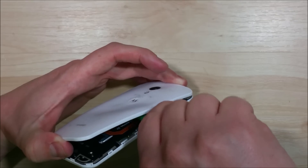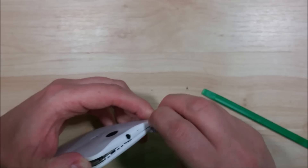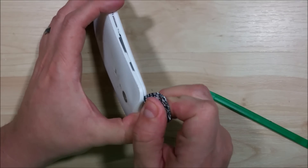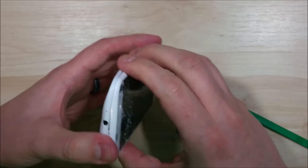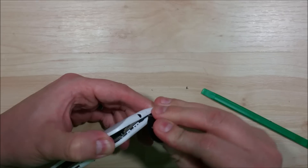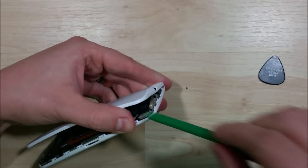There's a sticker on top of the battery — the X8 Motorola sticker. Pry on top of that and not underneath it. A large portion is undone now but the top re-clicked itself back in, so make sure those connections are undone. Go ahead and start to pull the cover back away from the phone. The headphone jack also has a crack in it, which was there before removing the back. It looks like somebody has undone this device before, which may be why it doesn't power on.